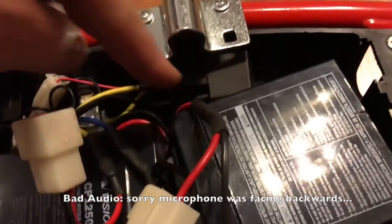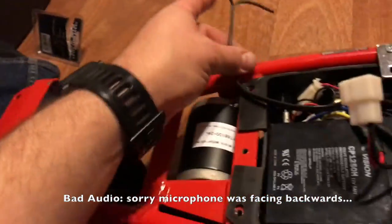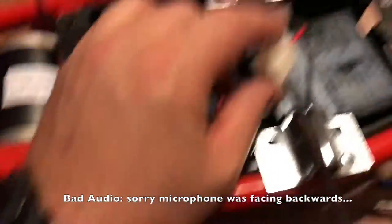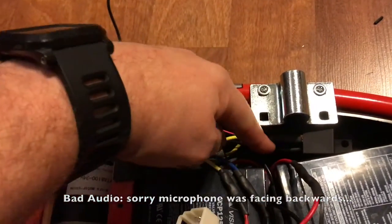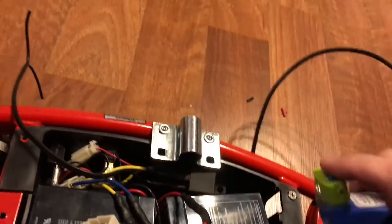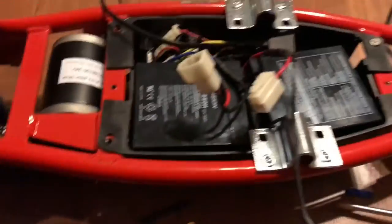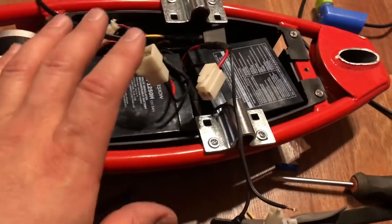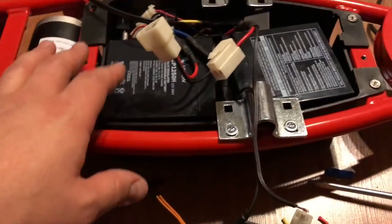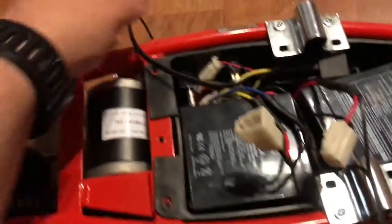This is unfortunately a 12-volt relay, and running it on 24 volts will burn it out, so I had to set up two separate power systems. Basically, 24 volts comes from the batteries on this connector, goes through the main power switch, from there into the relay, and from the relay out to the motor. I've got my existing remote and I'm just going to be using the blue button. I had to pull just 12 volts off of one of these batteries. I know it's not a good idea, but relays use such a low amperage it's not really going to make a difference. I'll be switching the relay on and off through these wires.